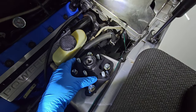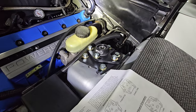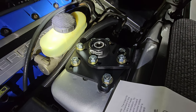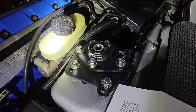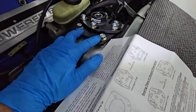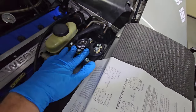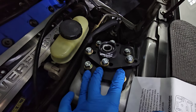Once you decide orientation, take the washers and nuts and nut them on — bam, you're done. Just reinstall your strut; I'll show the final product once I get the K-member in. Basically just follow the directions, make sure the top bearing plate is in the right direction for what you're hoping to achieve. On the bottom plate the four bolts handle your caster and these handle your camber. They give you specs in the instructions. My last car had negative two and a half degrees camber in front — I'll probably replicate that. That wraps this one up; moving on to the next part of the project.